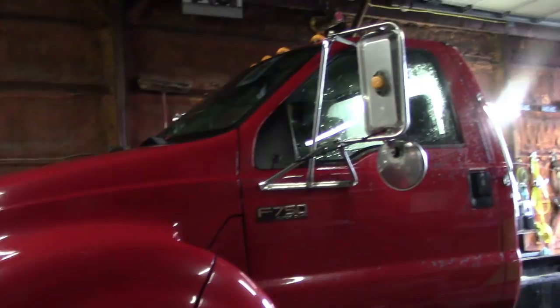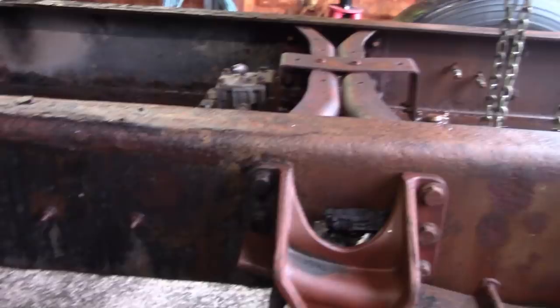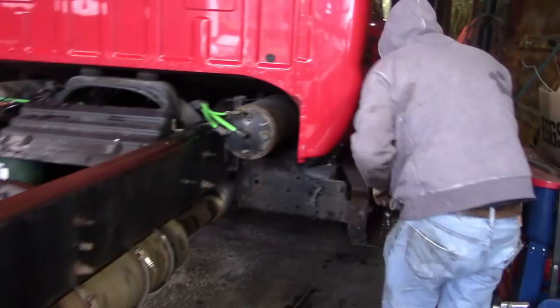The body's in really good shape — good hood, good quarter fenders, good doors, good rockers. It runs good, the transmission shifts good, battery's a little weak, fuel tank needs a little work. But you can see the frame here — look how clean that frame is until we get right here and then the paint's gone. So we're just going to cut it right in front of that leaf spring hanger, discard the rest, and replace it with a different suspension and differential. On this side, as you go forward, the frame's in good shape.